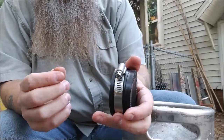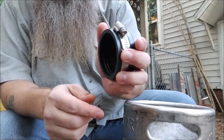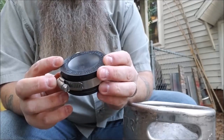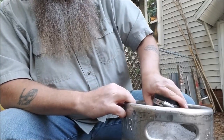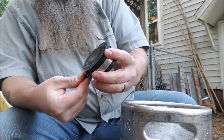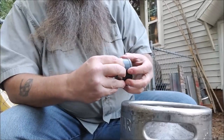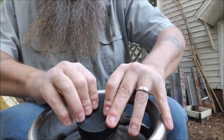Got a cool hose clamp to hold it on. For most US kegs this is a two-inch Fernco cap, which means it fits a two-inch PVC pipe. Two-inch PVC is two inches on the inside, so it's actually about two and three-eighths on the outside — but it's called a two-inch cap. If you go to a hardware store or Amazon, tell them you want a two-inch Fernco cap — it's a rubber end cap. Don't get the fitting that joins two pipes together, that'll be useless. I need to flex this to get it over the lip.